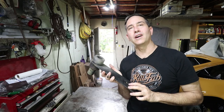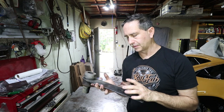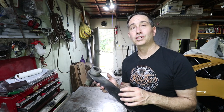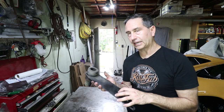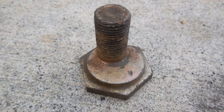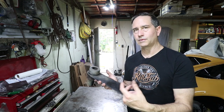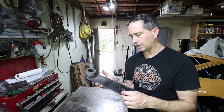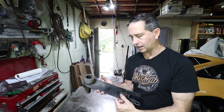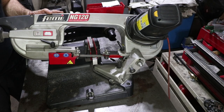While the paint's drying on the car, I touched up a few areas right near where this attaches to the car — it was hidden behind there. And I'm going to make a small change to the spring plate to make camber adjustments easier. The factory has an eccentric bolt that's like a quarter turn, and it's a little hard to keep track of and hard to reach. So what I'm going to do is add a block that goes underneath here, with a grub screw and a lock nut to drive the camber adjustment up and down.